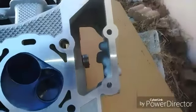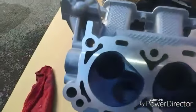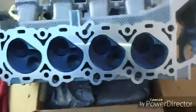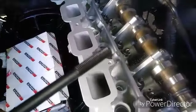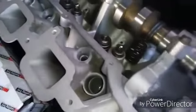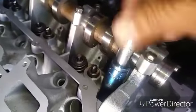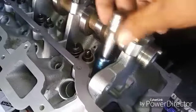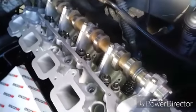So it should look like this - all nice and clean and shiny. Now it's time to put this guy on. Another thing you want to do is coat your threads - I'm using transmission fluid. You just want to get a little bit on there; you don't want to get it too sopping wet, just coat it a little bit. Then you put them in. You line up your head gasket, then you line up your head on those dowels, and the dowels will kind of hold the head for you. Make sure you get it on those dowels.